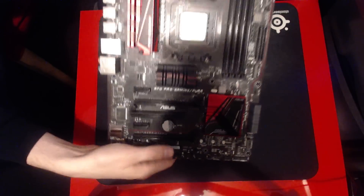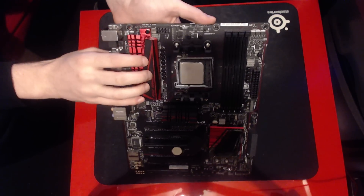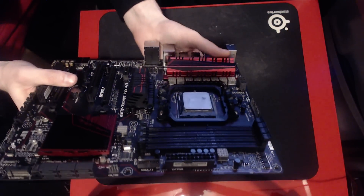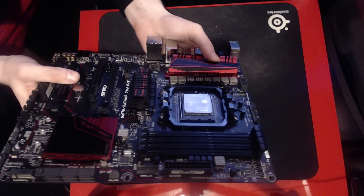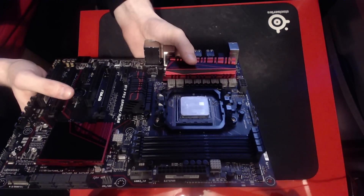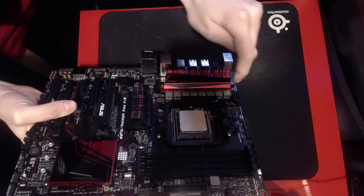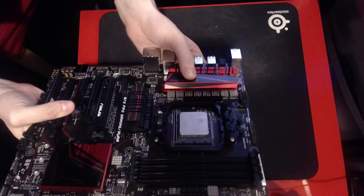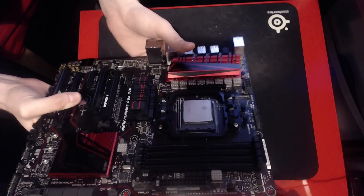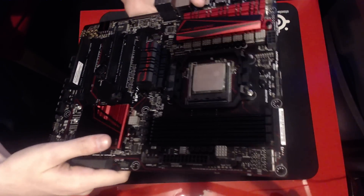So the interesting part — the VRM. This is a very unique VRM for an AM3+ motherboard. This is a 7-plus-1. If we take it from this angle you can see there are 8 chokes — 7 of those are for your V-core, and one of them is for your Northbridge voltage, the Northbridge built into the CPU. The remaining 7 feed the CPU calculation logic, the cores, L3, and all of that.